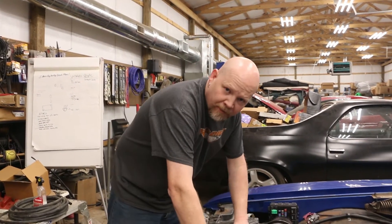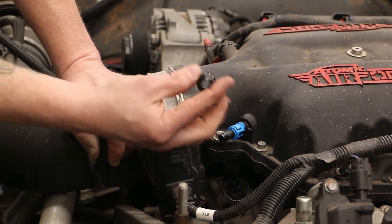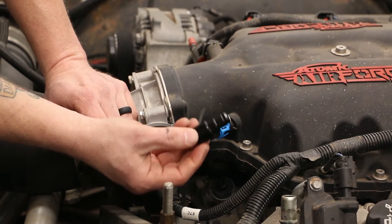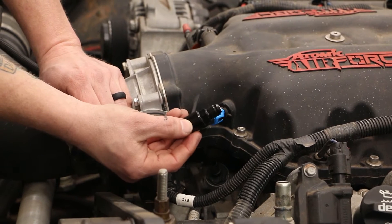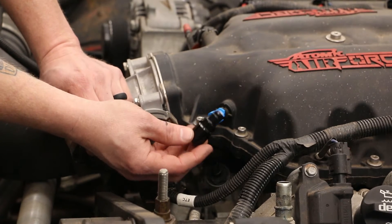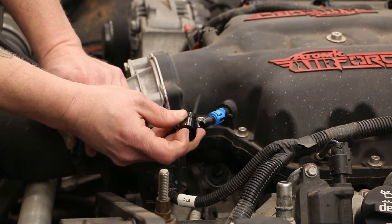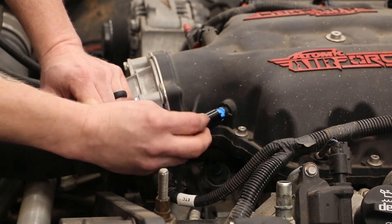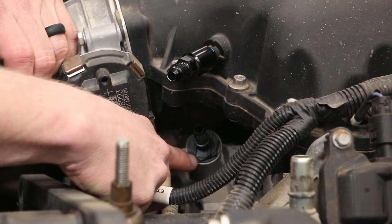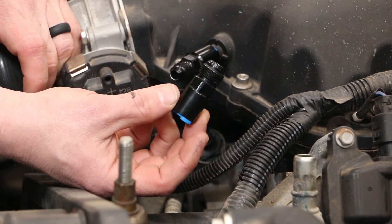So we're here on my '71 Buick GS. This is the vacuum fitting on our atomic air intake and this is the quick connect fitting we're going to use for the vacuum. This looks just like a GM quick connect for fuel, which is three-eighths, but it's not — it's actually 10 millimeter and they do not fit. You can drill the inside of this out and replace the three-eighths O-rings with 10 millimeter O-rings, which is what I have done here. Then that just snaps on. This fitting right here is a 10 millimeter fitting and we're using a dash eight on this side.